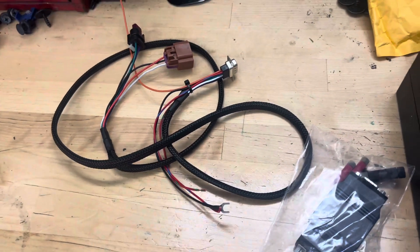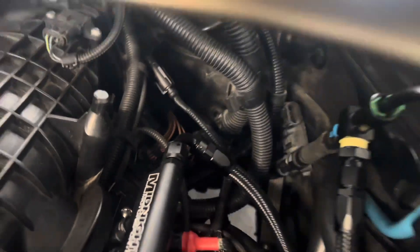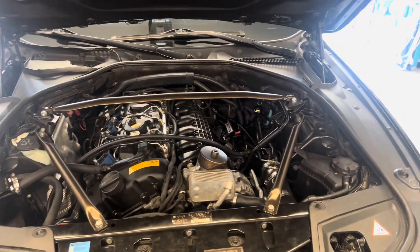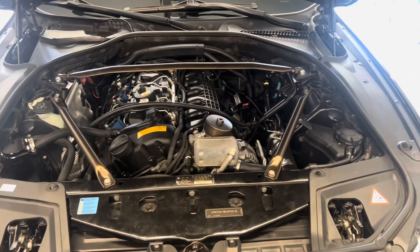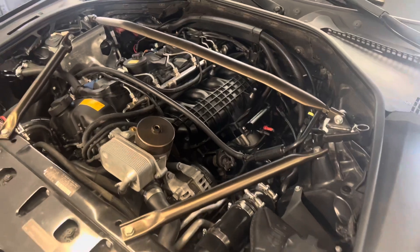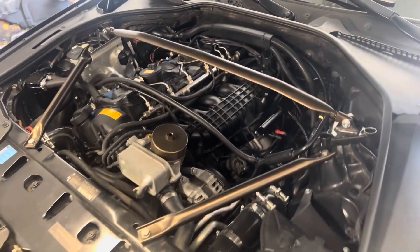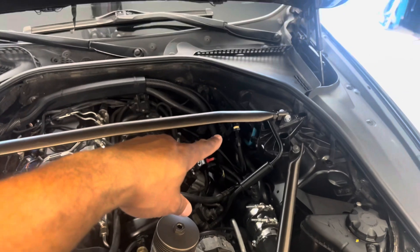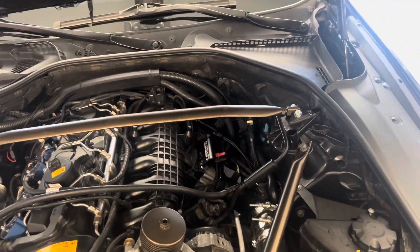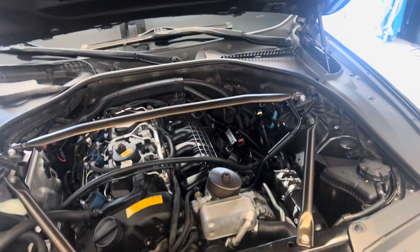One thing I've noticed from my old E85 sensor install — my E85 sensor is right here. A little bit further down, I had installed a pressure sensor so that I would actually have that low pressure fuel line sensor right before the high pressure sensor, so I could tell what the low pressure pump was putting out. But because I have an early model N55, I actually still had a low pressure sensor right before the high pressure fuel pump underneath the intake manifold, so I have not been using that sensor that I installed.